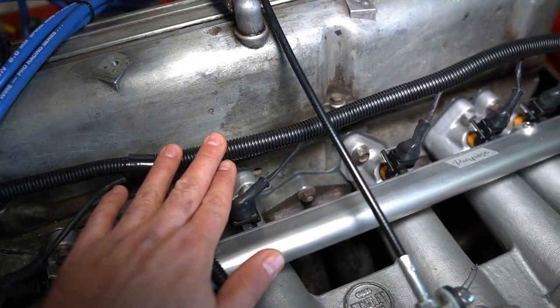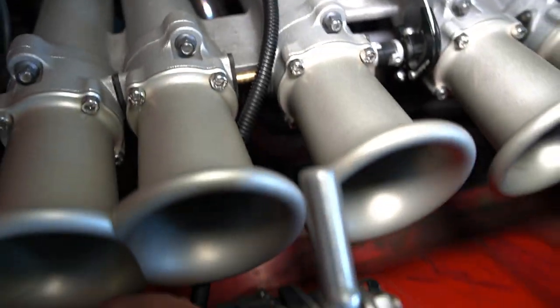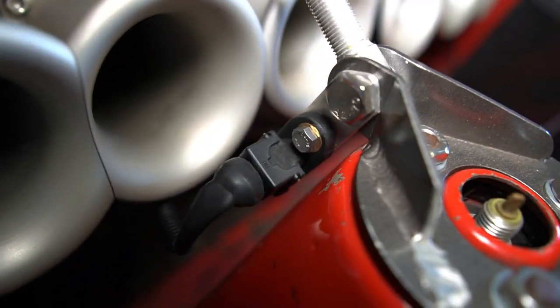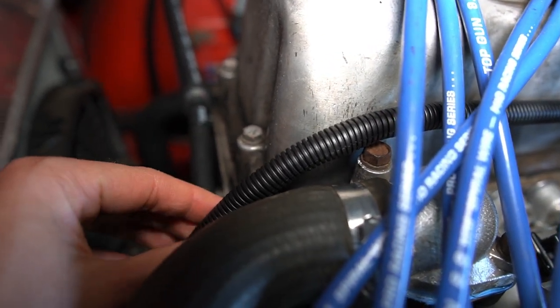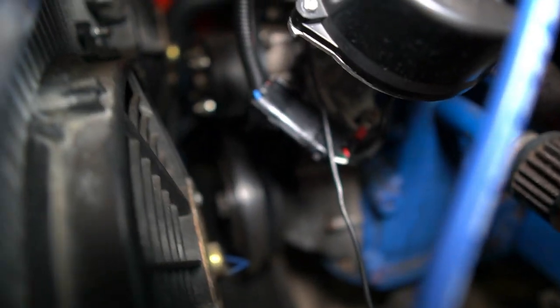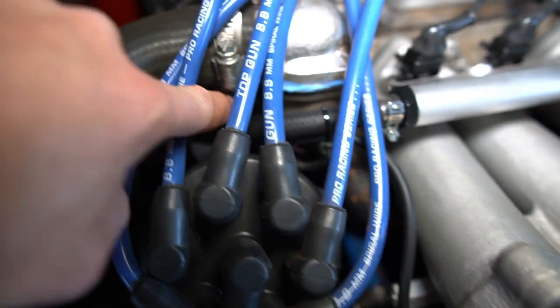You can see it goes along here to these injectors using the swanky 90-degree boots. The first sensor to jump off is the air temperature sensor, which is still attached to my Z-Story strut brace and positioned close to the trumpets. Once the last injector tapers off, the remaining wires are just for triggers and sensors. That's the connector to the Nissan optical distributor, which is inside there. And my temperature sensor is on the front of the thermostat housing.